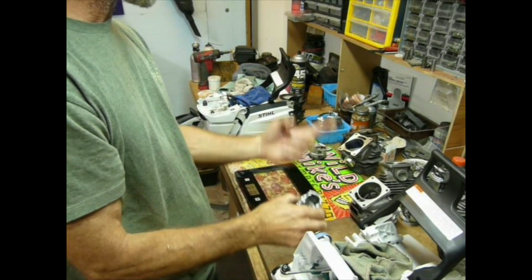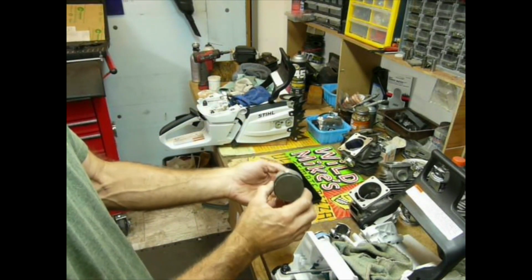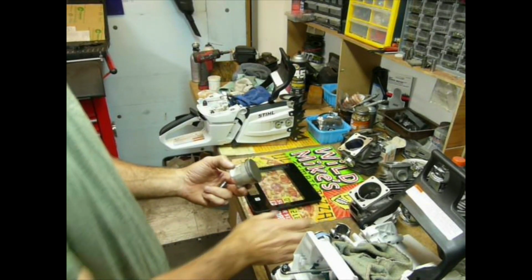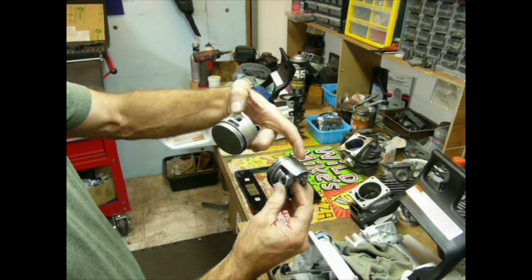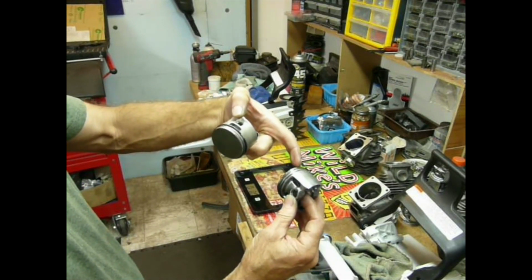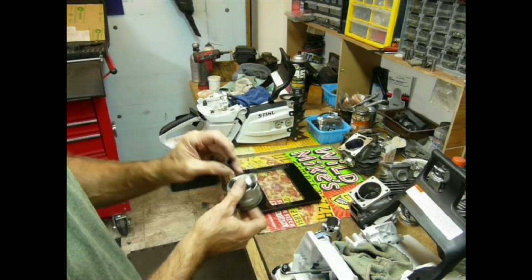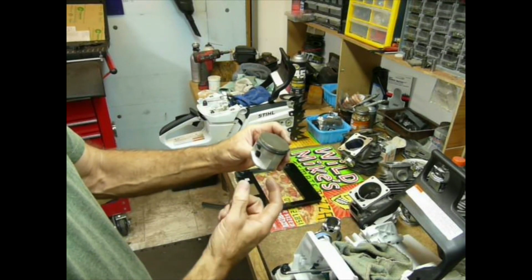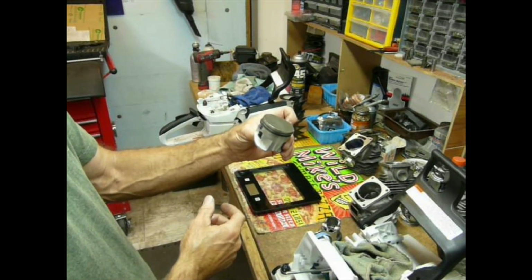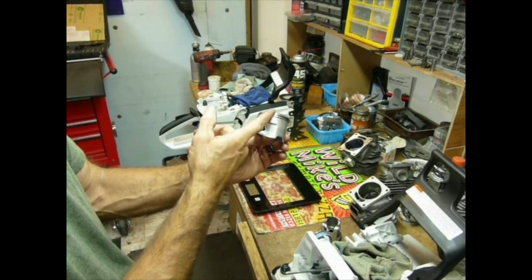I don't know if that's correct in the pronunciation, but conceptually. This one's a little bit different. It's about 5/1000ths in difference. The differential from the widest to the most narrow part is about 5/1000ths, and this piston's is like 7/1000ths. There is a little bit of a difference in the design. This one is a little bit oval. I'm trying to remember now, I think it's 7/1000ths of difference.